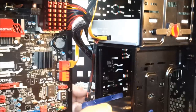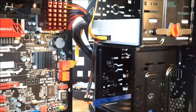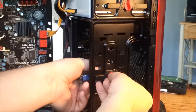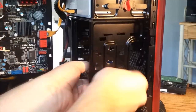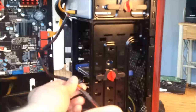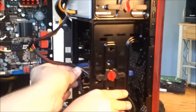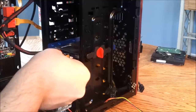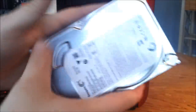There's the SSD install — it's the Kingston HyperX 128 gig. I got that one because it had the fastest advertised read and write speeds, and it boots up Windows really fast. Again, there's the tool-less installation. SATA power on the left side — put that in snugly. Then get your SATA data right into the motherboard and right into your SSD. That's ready to rock and roll.